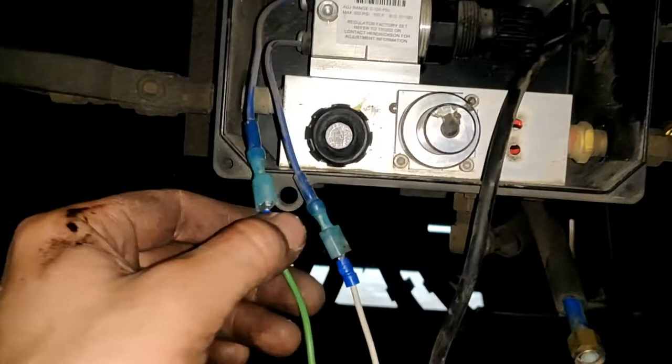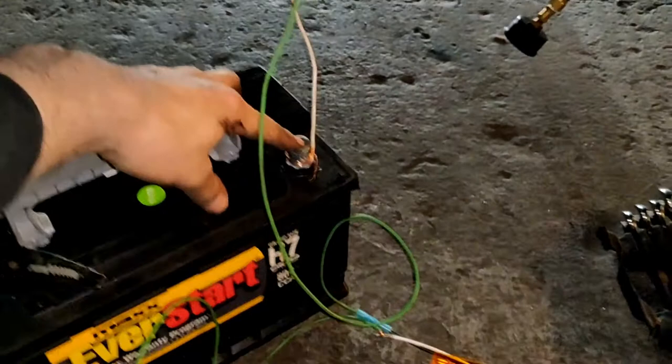Usually this light is on the front of the trailer. It has a minus directly from the body, and the plus is coming from this side going back to the light. Right now we're using a battery — the plus is going through this cable and coming back to the light through this cable, and the minus is from the battery.